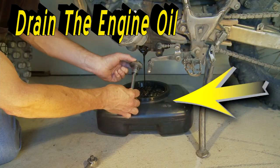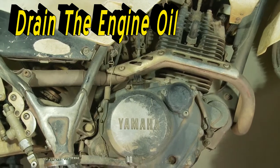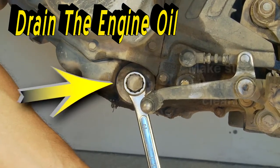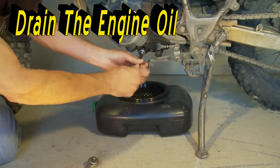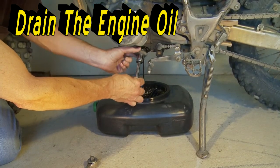Locate a suitable oil drain receptacle. You can cut the bottom of a plastic jug out or use a commercially made drain pan like the one shown here. Remember, you'll be draining about one quart of spent oil from the engine. Loosen the oil filler plug first to allow air to enter the engine's crankcase. This may smooth the drain oil stream flow. Using a 19mm socket or box wrench, loosen the crankcase drain plug by turning it counterclockwise. Use six-point tooling if you have it. Once loose, a socket with extension will help remove the plug completely. Make sure to remove any dirt around the plug before removing it.